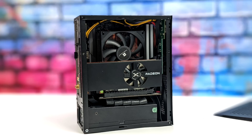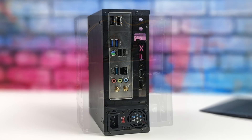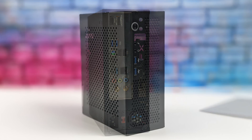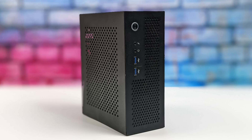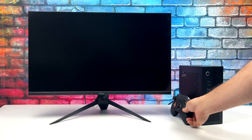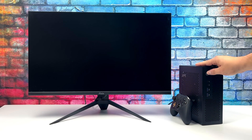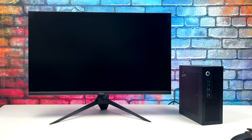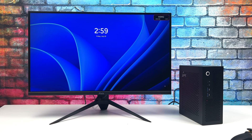I think this little thing came out really nice. We've got that 300 watt power supply, so we don't need to worry about power delivery to the GPU or CPU. I personally really like the look of this case — you can mount it vertically or horizontally. I'm going to go vertical with it. This thing is super tiny; it'd be great for a living room setup. Since we've got that RX 6400, we could always install SteamOS 3, otherwise known as Steam Deck OS — it works much better with Radeon GPUs, so you could have a real console experience. But right now I'm running Windows 11 Pro.